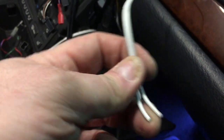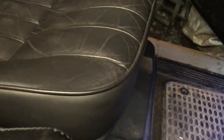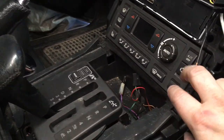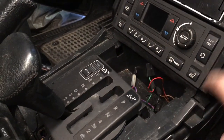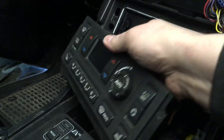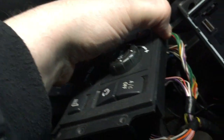I cut off my switch for the air suspension and I'll reroute this one. This wire goes under the hood and disconnects the power there, but instead I'll run the wire down through the center console, under the seat, and disconnect the power at the timer relay under the driver's seat. If you ever want to remove the heater controls, you don't have to remove the wood trim — you just remove the two screws on each side, four screws total. You do have to remove the side trim because it covers those screws, then just gently fish it out, being careful with the display. All the connectors are on the back — just disconnect those and pull the whole unit out.